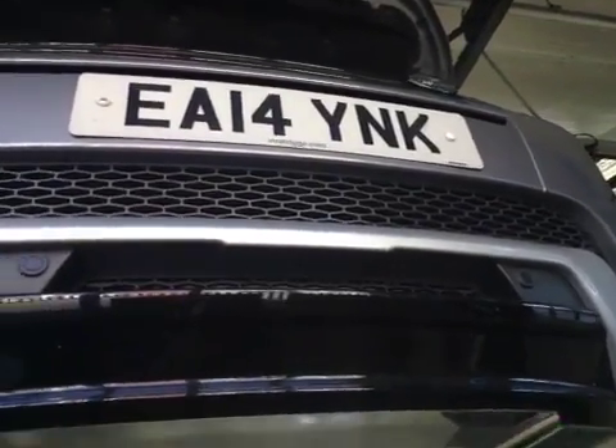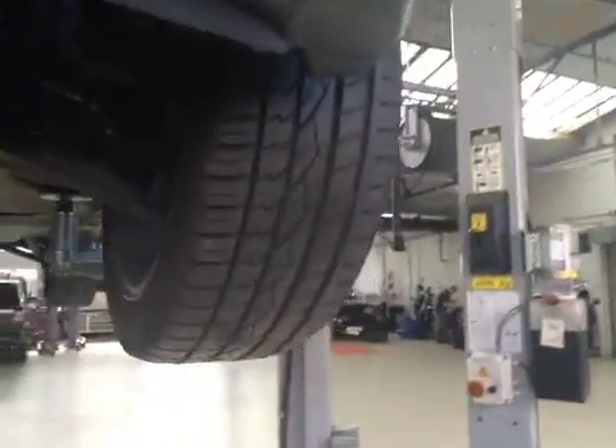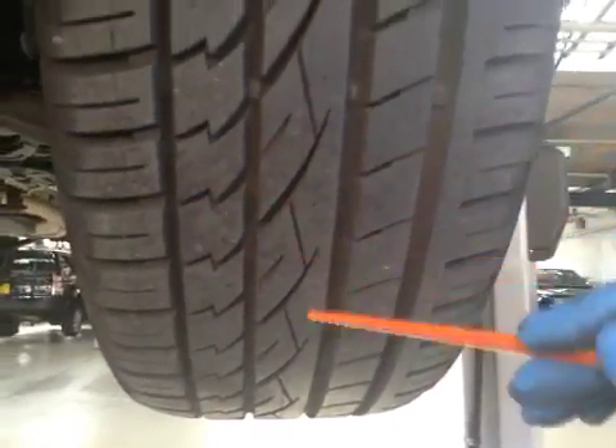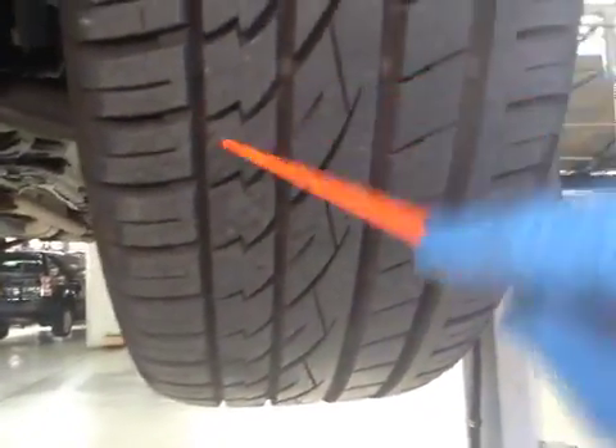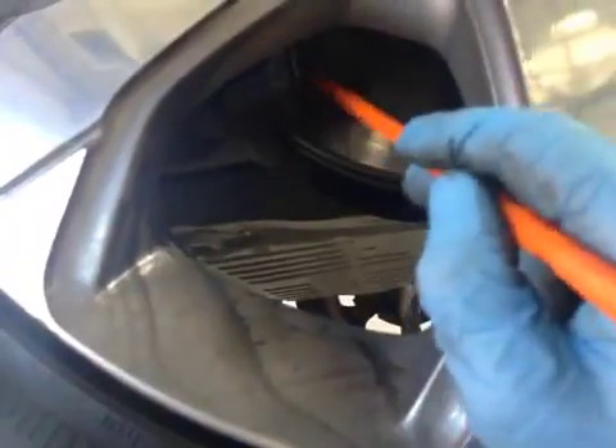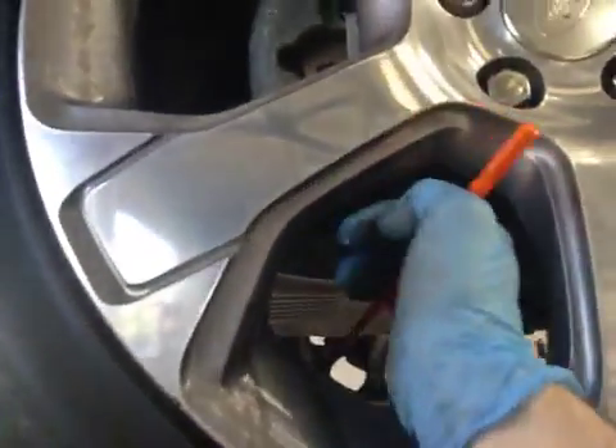Hello, my name's Ian and I'm coming out of vehicle inspection. This is the passenger side front tyre. The tyre is in good condition but it's just gone below 5mm, so this tyre is in amber. There are no signs of foreign objects inside the tyre. Your front discs are in okay condition and your front brakes are on roughly about 10mm, so the pads are green, disc green, tyre is in amber.